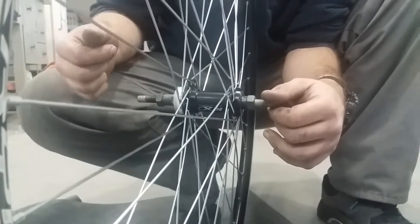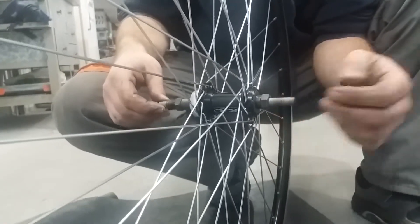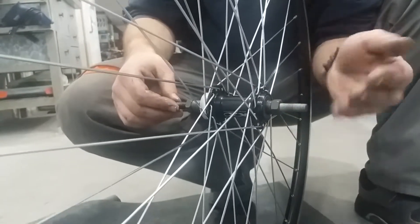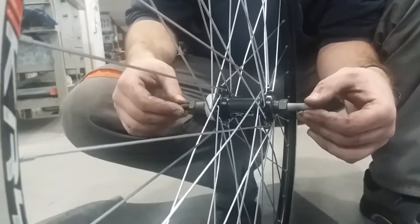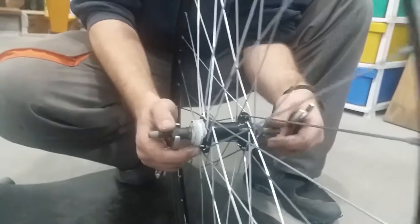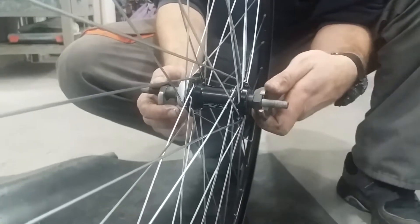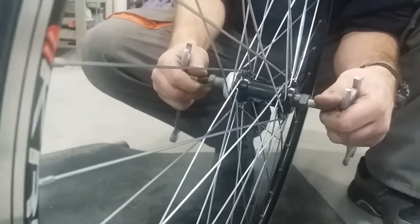This wheel does have an extremely poor bracing angle of the right hand side spokes — they are almost vertical. Not sure if that's visible from the video, but it is a 36-spoke wheel with a very strong rim that can take a lot of spoke tension. The left hand side spokes, although with much lower tension than the right hand side spokes, will still have enough tension not to become slack and loose over time after riding. This particular bicycle will be used for road cycling, so it will probably be fine, but like I said, it is preferable to widen the dropouts.